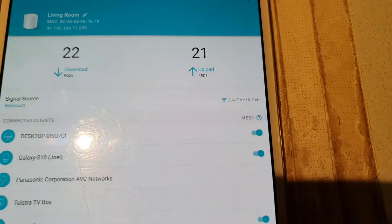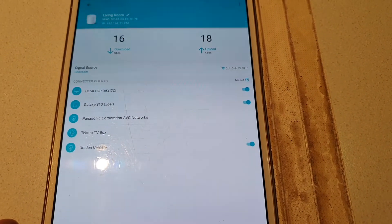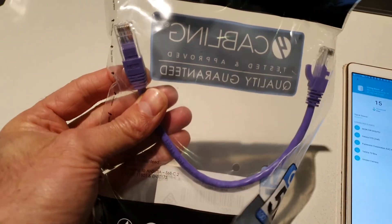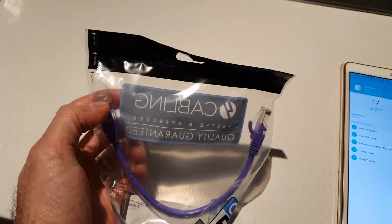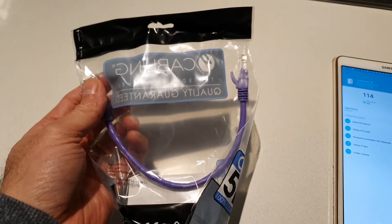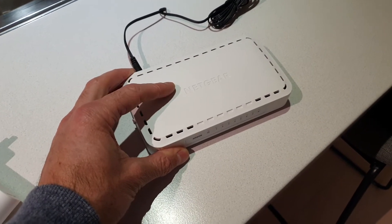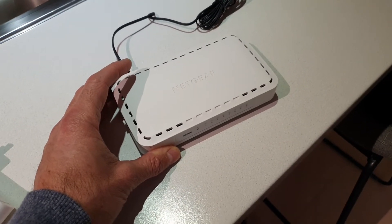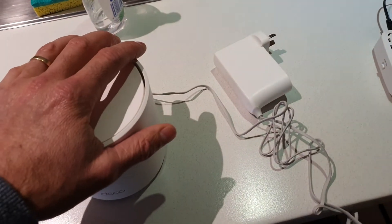So it's not getting the Ethernet backhaul. I'm trying to troubleshoot whether it's the Hills Home Hub — I had some original Ethernet cables that had been sitting in there for quite some time, so they may have worn down. I've got new cables, or it could potentially be an issue with the switch. Even though they're brand new, some switches don't like backhaul. The Netgear one should be fine — typically some D-Link ones don't like Ethernet backhaul.